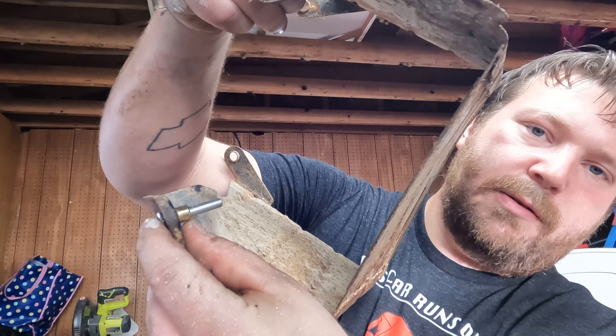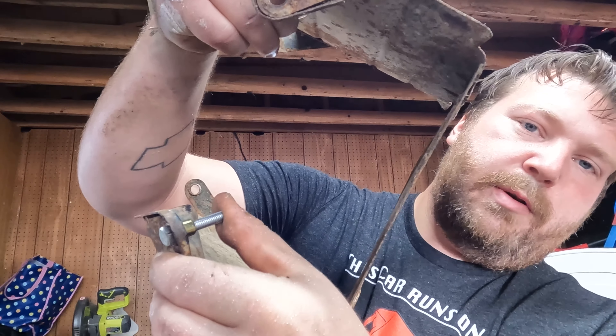Other things — any kind of custom mods that you want to do, say you want to add something to a firewall or even a fender or something like that, you can use a rivet nut tool. They're very, very handy. I use them anytime I can, instead of using self-tappers or instead of trying to drill something to re-tap it. A rivet nut has plenty of threads to hold on to, so whatever you are securing to the car, you have the peace of mind that it's not going to go anywhere and it's going to be safe.